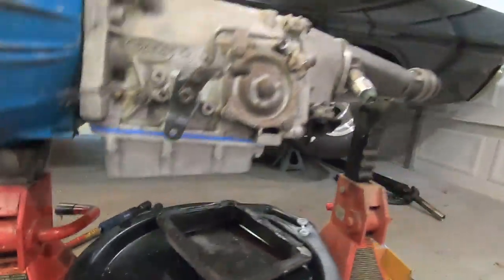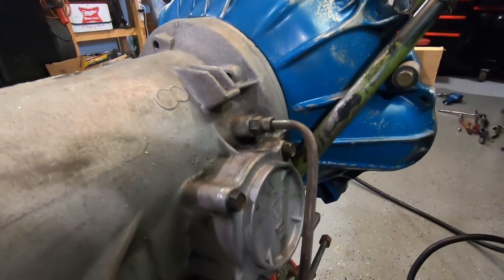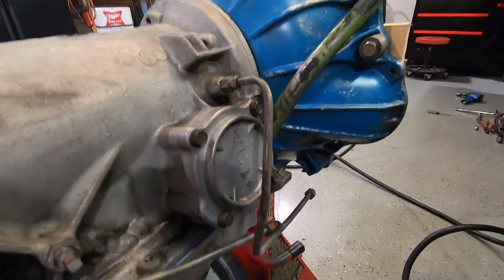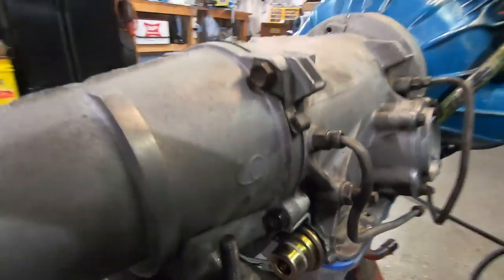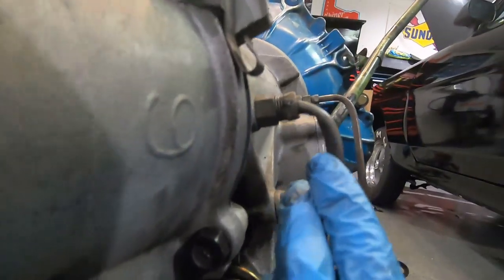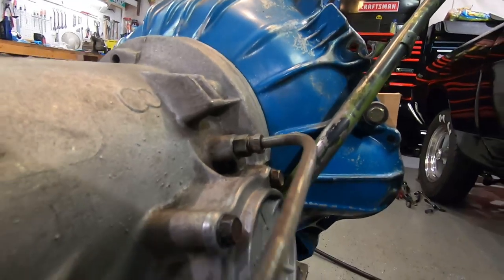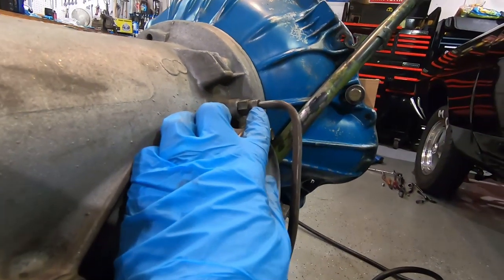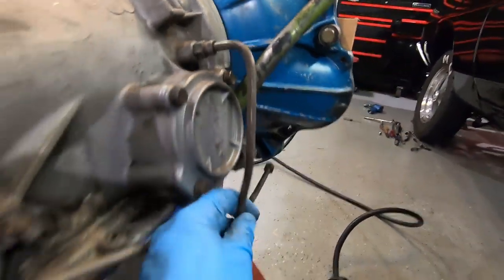The transmission pan is on — the new pan looks pretty good, and with the new gasket we shouldn't have any leaks there. What I've noticed is this line is your output to the cooler, coming right off the pump, and this goes up to the front cooler with fluid returning on this line. This line is responsible for feeding the tail housing. We've got a crimp in the line right here, which isn't helping our flow. I'm going to try to de-crimp that, and I may have to replace the lines. This other connection is loose, so I need to tighten it.